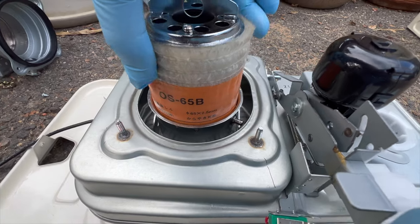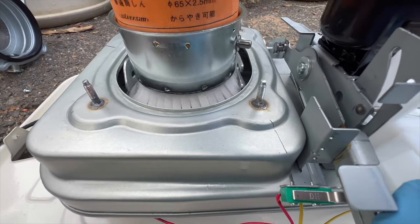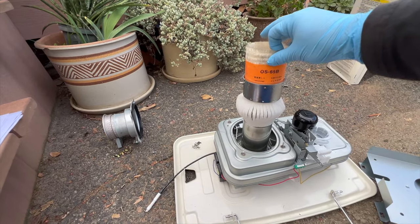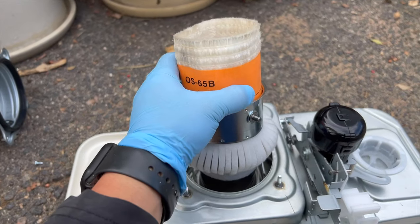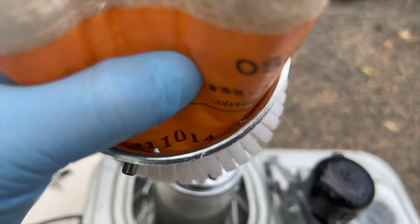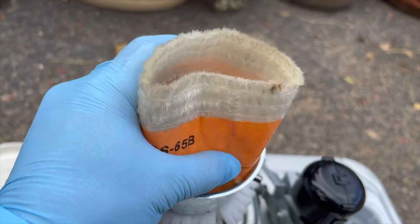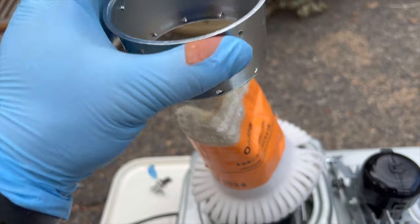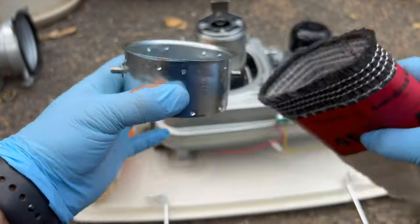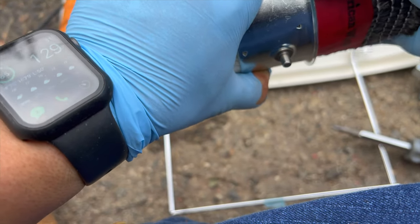Once it's snapped out of place, pull the lever down a little — this brings the wick up and makes it easier to pull the whole wick out. Now that the old wick is out, you can replace it with the new wick. To remove the wick from the holder, push into it — there are small hooks on the inside that hold it in place, just push all around. The new wick has a black line that lines up with the top part of the holder; once in place, push it through into the little hooks.